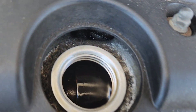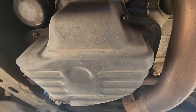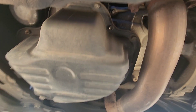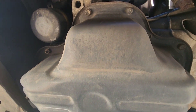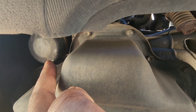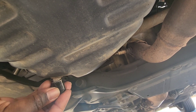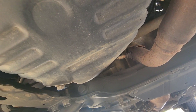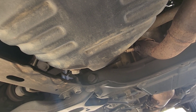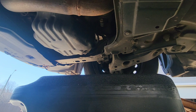What we're gonna do is go ahead and drain the oil. Once you're up under the car, go to the oil pan right here. That over there is the transmission area. The oil filter is up there at the top, and that is the drain plug. That plug is a 14mm — so use a 14mm socket. Basically what we're gonna do is loosen it and then let it come out. Make sure you've got your drain pan under the car.